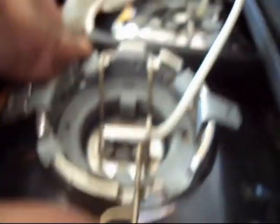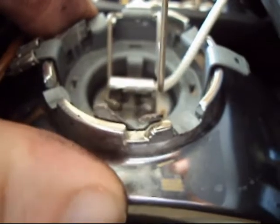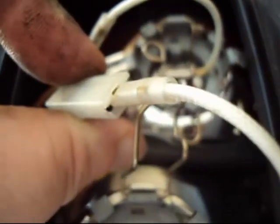This is how you replace these inner lights. Down with your thumb, across, pops up, tear off, and you should just be able to pull the centre part out. And there's your bulb — and this one's a good one. There's a connector there. Never touch the bulb. Pull that out and we've got ourselves a spare bulb. We don't know whether I'll ever use them, but I always keep the spares.